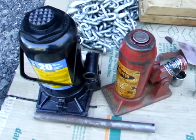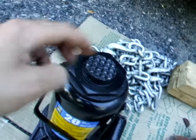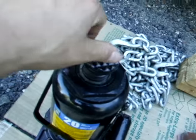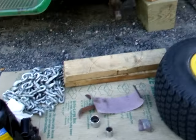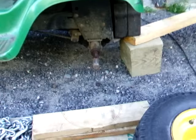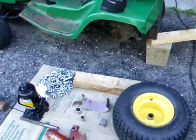These jacks sometimes don't work sideways — this one has an arrow and has to be mounted in a specific orientation. This one had started running out of fluid when extended a certain amount, and I had to unscrew it and push the piston back in so it had enough fluid left when on its side. Unfortunately I didn't take a video while I was doing it, but if you stay tuned I'm going to set it all back up so you see exactly what I did. Hope this helps someone.